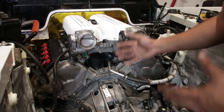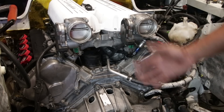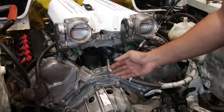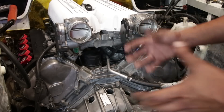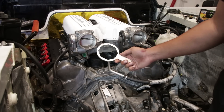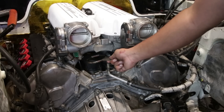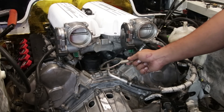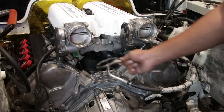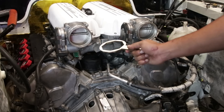There are a few quirks about this engine when it comes to oil changes, and the main one has to do with the oil filter. The oil filter is right here, and it's not in the best position — it's actually in the V of the engine. In order to change it, you need one of these special oil filter removal tools made specifically for this car, which costs about $35. But this filter is a cartridge-style filter, and it was almost $80 — a little more than I wanted to spend.